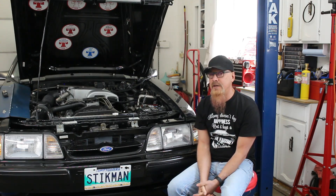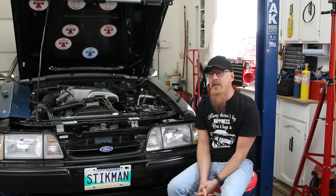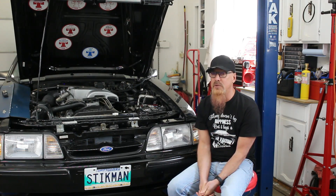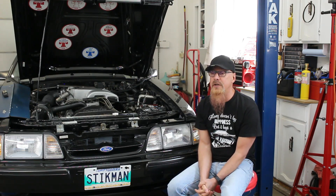If you watched last time, we tried to get a handle on the clutch adjustment and everything went sideways, so we still need to do that. I fixed the header problem, and off-camera I already went and dialed two turns out of the clutch because the last data log showed it was locking up completely. We knew we had too much clutch adjustment. I took it for a quick drive and two turns was too much — even under moderate acceleration you could feel the clutch slipping. So I need to put one turn back in there.